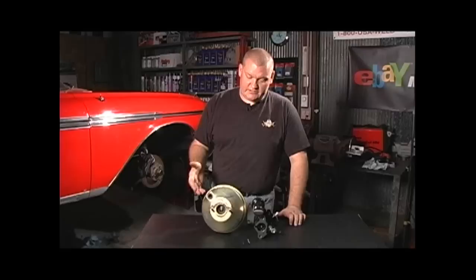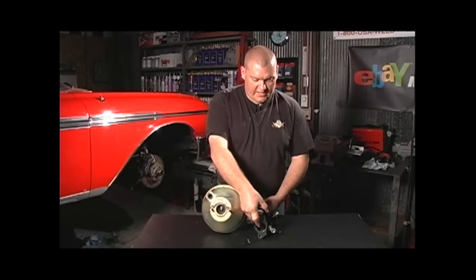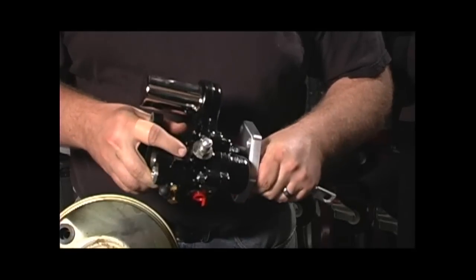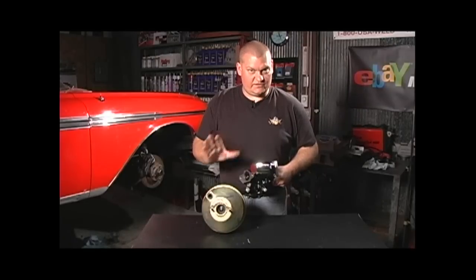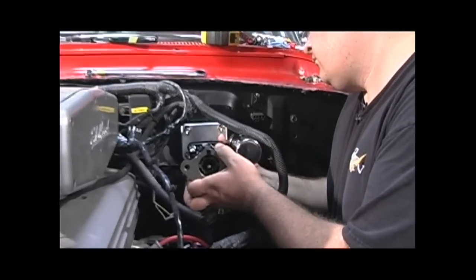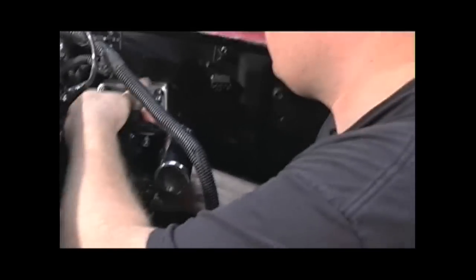And if you've got tight quarters, it's not going to be helpful. The HydroBoost unit also has some different connections. There are a couple of hydraulic lines on the bottom side, and this big shiny thing here is called an accumulator, and this is what makes sure you have extra stops stored up in case the car loses power while driving. You can remove your vacuum booster and reinstall your HydroBoost unit right in place — really, all you have to do is bolt it on.